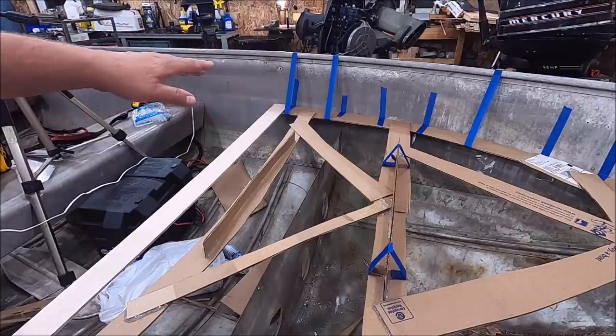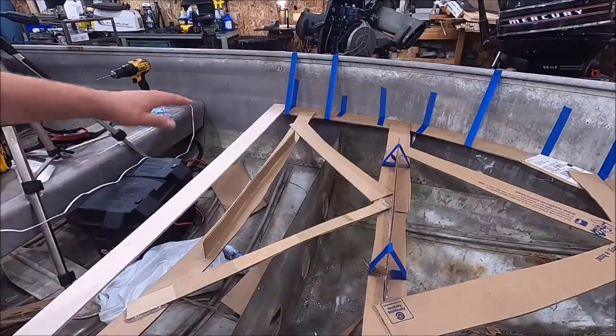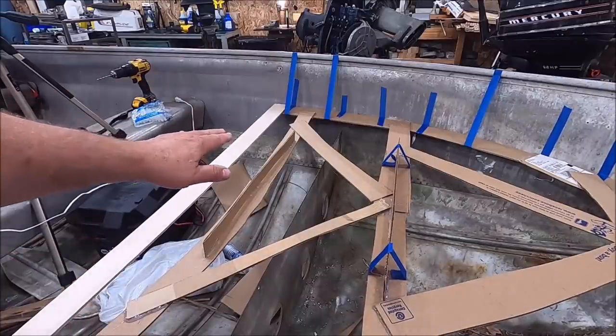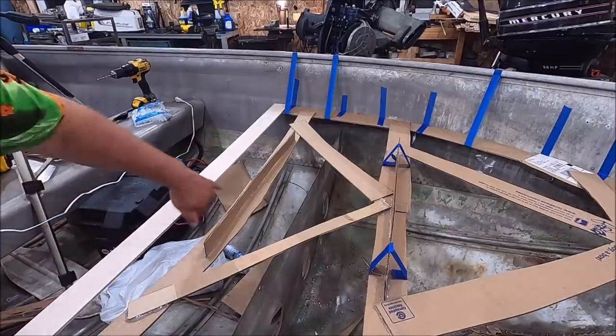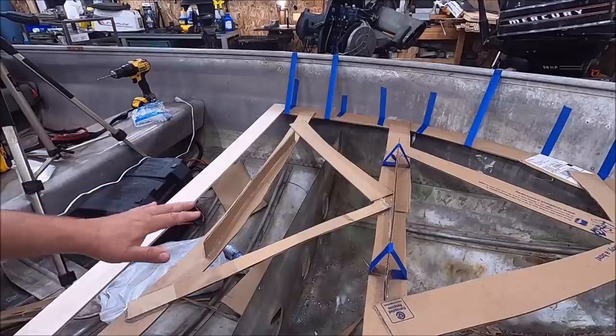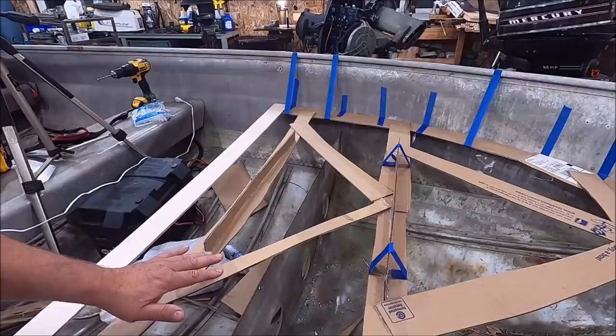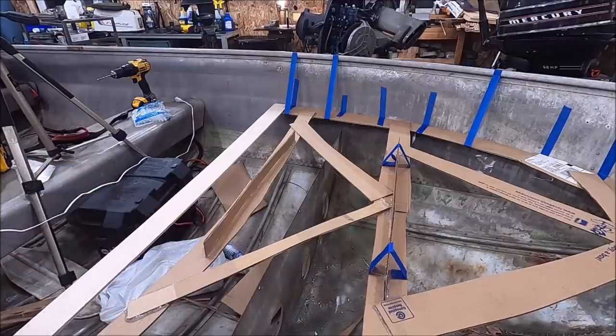And you'll see as we go along, I'm going to put another piece of angle support here and on the side opposite of that to help support the plywood. And I'll put some framing underneath here as well to help make it stiff. So it's going to make it nice when you step in and out of the boat at a boat dock, that you can step up onto here first versus the seat and step out, and you've got a nice big platform to stand on.